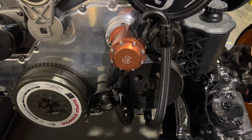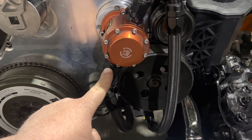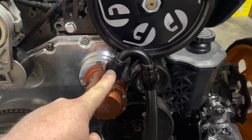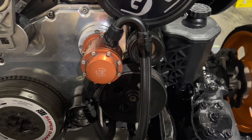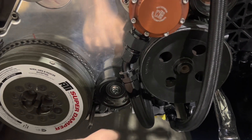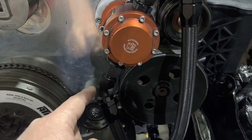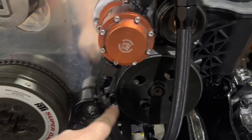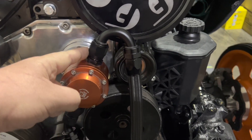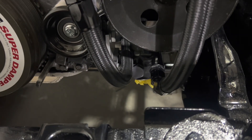I'm going to start off by showing you guys the mechanical fuel pump setup on the common rail. The larger fitting here is the fuel supply — this is coming from the tank — and then the smaller fitting here is the high pressure side going to the filter, which ultimately ends up into the CP3s. We used a dash 10 on the suction side. You could also use a dash 12. This particular Waterman setup has the fitting setup for a 12, but a 10 is more than sufficient. We also have it set up with a dash 10 on the high pressure side.